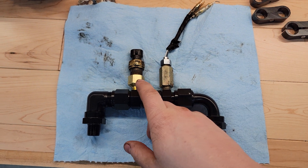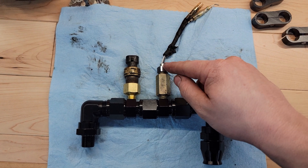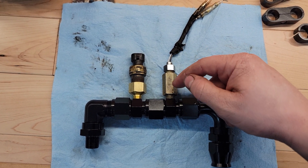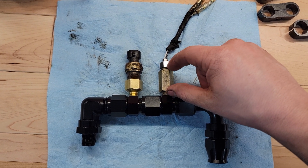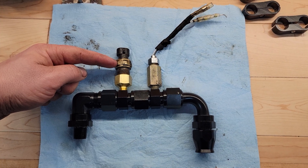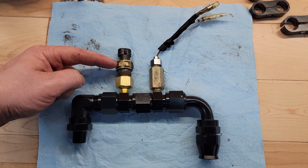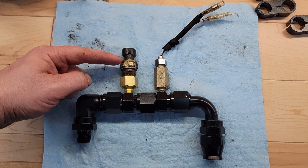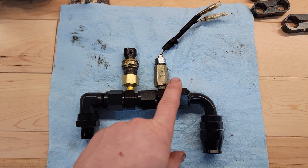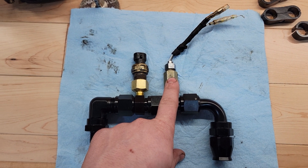Here's a visual of the sensors. Here's the stock sensor — 3/8 MPT male. And here is the aftermarket transmission sensor I'm using — that's 1/8-inch MPT. It's just a little long, so I have this 1/8-inch MPT spacer adapter. So: stock sensor and aftermarket transmission temperature sensor. The stock sensor measures the transmission temperature coming out of the hot line and controls whether or not your truck can go into overdrive — if the transmission is too hot, it won't allow overdrive. The aftermarket sensor is just going to tell me the temperature on my aftermarket gauge in the truck.